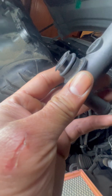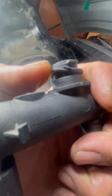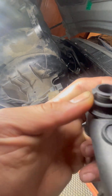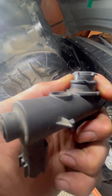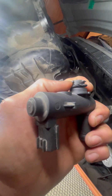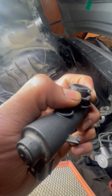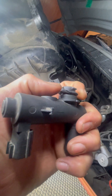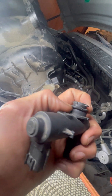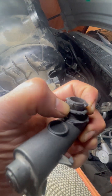Let me move into some light — this is the one I got, and as you can see, this O-ring was chewed up when I took it out. I smoke tested the whole vehicle and there were no leaks found. It's a super minuscule leak — so tiny that you couldn't even find it with a smoke machine because you're only putting one PSI through the whole system, which is not a lot.